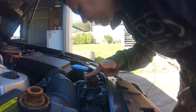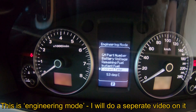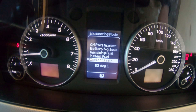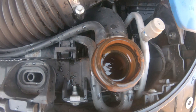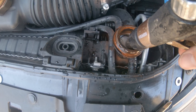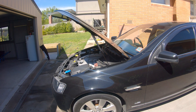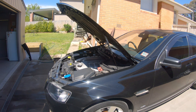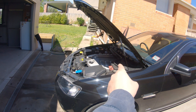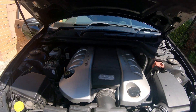Okay, that's topped off — let's fire it up and watch that temperature rise. We're at 90 degrees, the thermostat's open. I've just switched the car around for two reasons: one, better lighting; two, now that we're on a gradient, when I drain, hopefully everything that's in the block will drain out as well, so we get a nice even flush out of this thing.